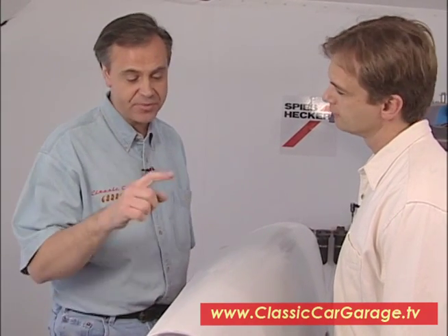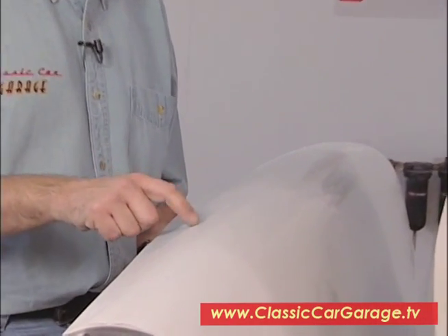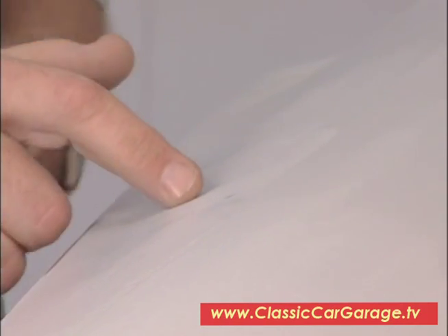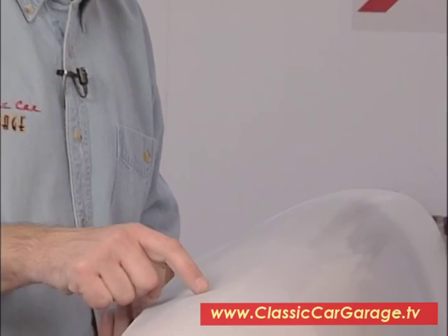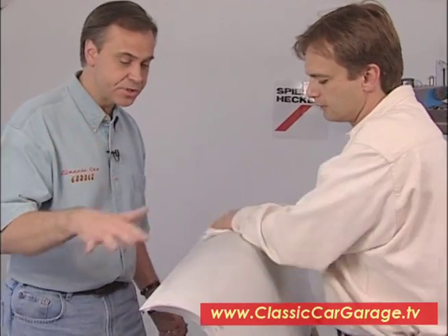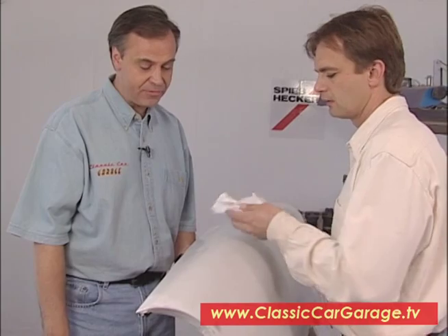Welcome back to Classic Car Garage. We've sanded the guide coat off here with 150-grit sandpaper. The only place we can see we need to do some body work is right at the top — this is where that little hole was that was welded up. This car started life as an ambulance, so it had big mirrors on the side, and this looks like the only place we'll need to do some body work. So the first thing we want to do after 150-gritting this down is clean it up again using our Spies Hecker Pre-Cleaner, to make sure there's no dust or oils in there.